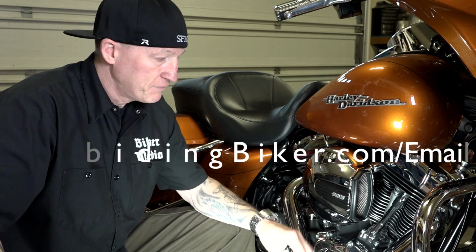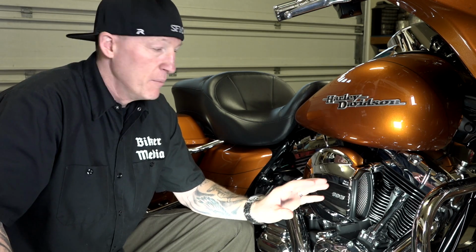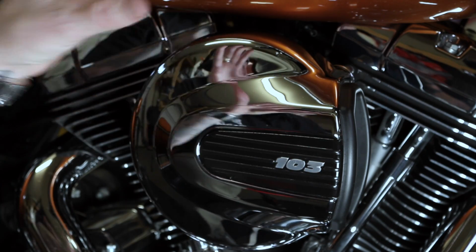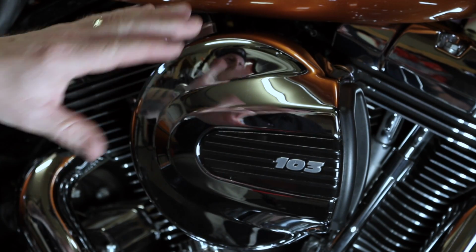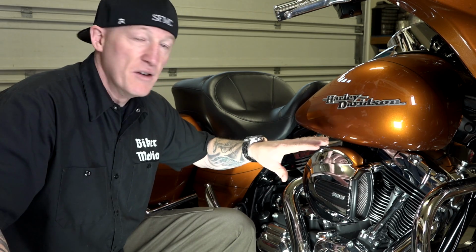All right, so remapping. We generally tell people, you could go to Harley-Davidson at this point and get a stock canned map. Basically, for your pipes and your intake, they'll put a canned map in there. Maybe at the time of this video, probably about $250 to $300. You're done. It's a canned map. It's going to run fine. It's not going to be optimal, but it's going to run good. Bad thing about doing that, guys, is if you ever change your pipes or decide to do a different intake or anything to your bike, even higher end stuff to your motor, you have to go back to Harley every time and pay them another $300 for that simple download.